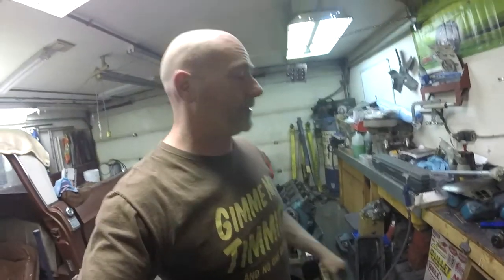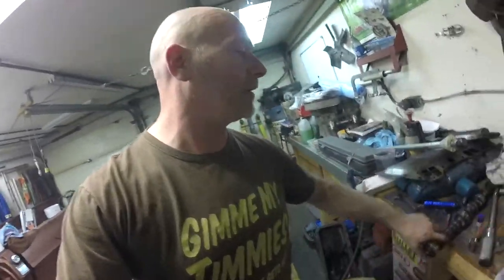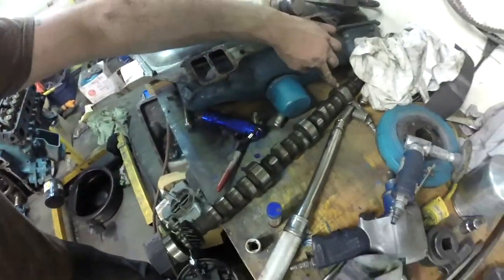The oil holes on number 4, the oil pass-through holes, there was actually a little bit of manufacturing junk in there. Nothing crazy. Could it have blown out and not did any damage? Sure, but we sure don't want to find out. It could have blocked up a passage or something. So anyway, camshaft done. One more step closer.